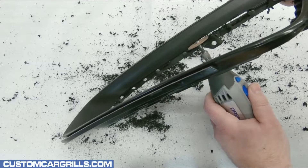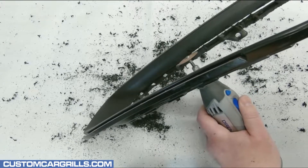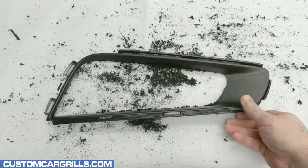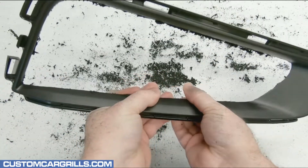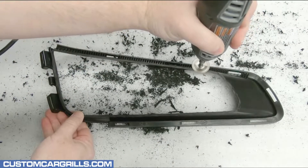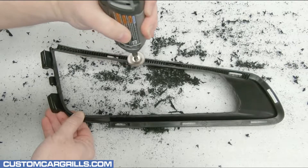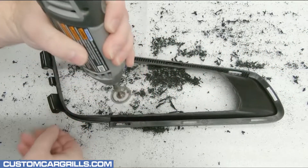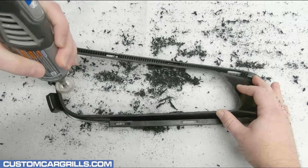I want to get the cutting wheel in there so that the back of it will be a nice and consistent flat edge. Again, once the cutting path's start and stop points meet, the cut portion should drop right out. There's going to be a few large burnt plastic bits that can be picked off by hand. Then I'll flip this around so I can work on the back of it. The top of the shaping wheel is abrasive and makes short work of evening out this cut edge. I'm not cutting deep in with this motion — I'm just evening out everything where it's needed.